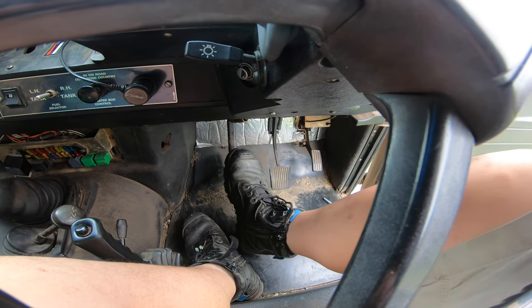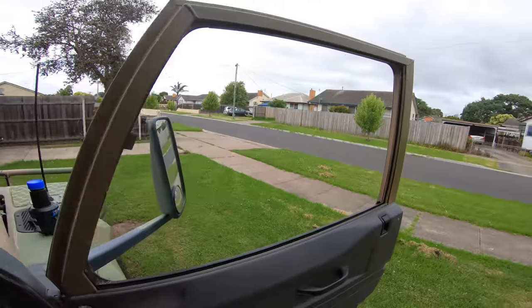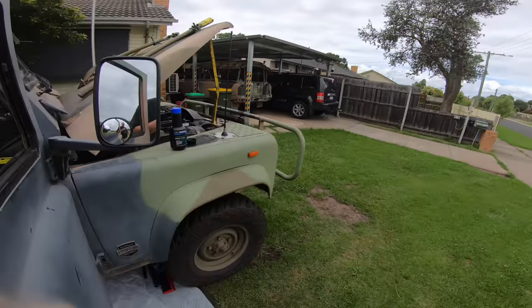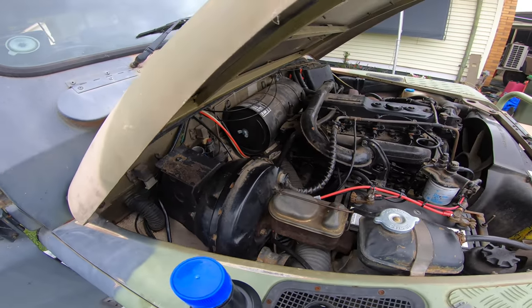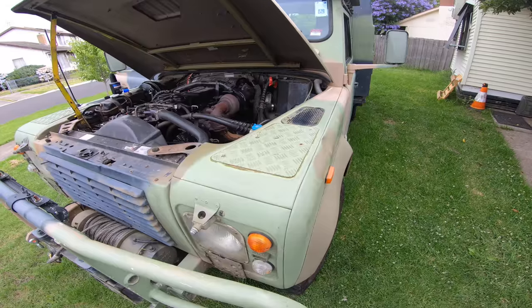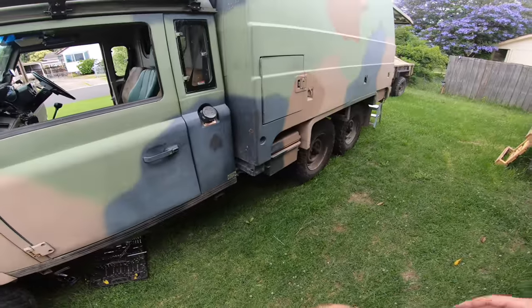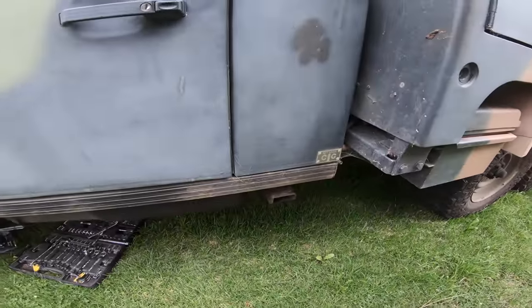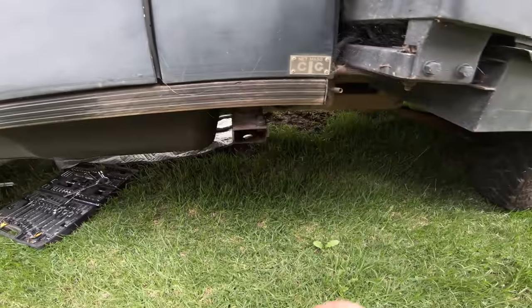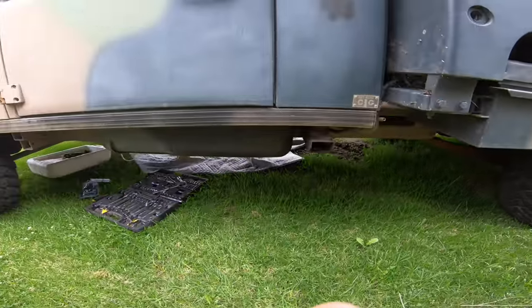It's pumping a bit of fluid through now. Let's check our reservoir, make sure we're not running empty. Yep, that was our reservoir running empty, so we're going to be here for a bit. Alright, so I've discovered four pedals is about the magic number before you want to top up the reservoir without getting air in it. While I'm pumping, I'm going to chuck the GoPro down below here and record that reservoir.